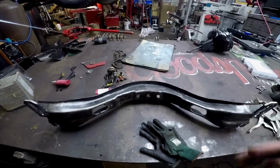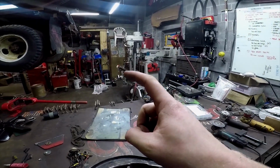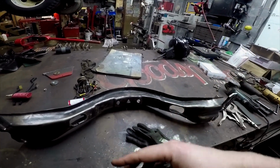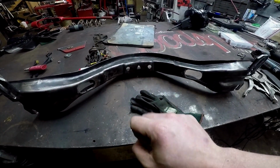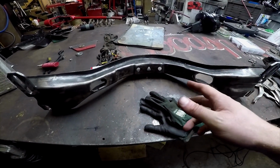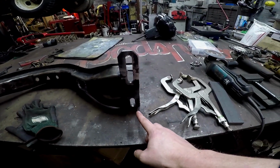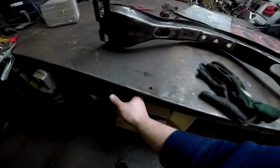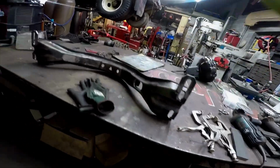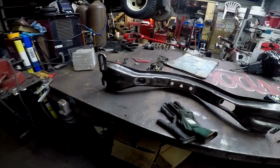Okay, so I went ahead and slotted the holes on the mill using about the sketchiest setup that I've ever used in my life. And I'm actually really amazed that it didn't throw the part across the garage, but it didn't, so that's okay. These holes, which are for the motor mounts, whoever built this had loosely cut these up with a cutting torch. So I used an annular cutter and just a 1/2 inch or 5/8 end mill and just cleaned them up a little bit. And these holes on the end are slotted way longer than they need to be, I think. So I'm hoping that'll work out the way that I need it to. The holes are like 5 inches apart, and I've got 6.5 inches of slotted holes. So hopefully they'll fit. So now it's time to put it back in.